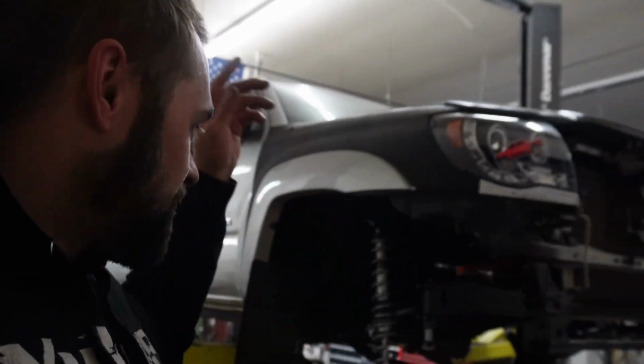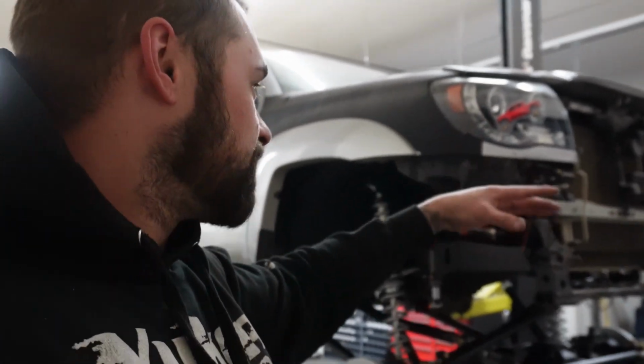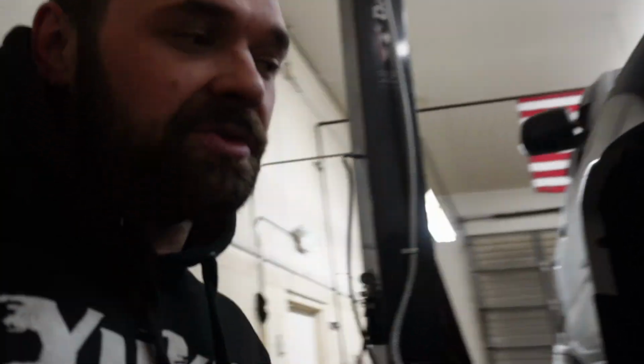We're gonna be getting the brake system all installed. So we're gonna be building an adapter to adapt a Dodge master cylinder to the Tundra booster that we're gonna mount in this thing. I've already got all the brake lines, so we just gotta hook everything up. A couple little tabs to weld on the back to hold some bulkheads, but nothing too crazy.